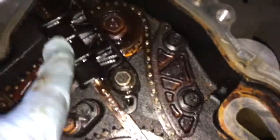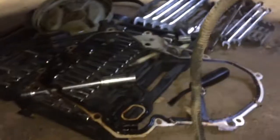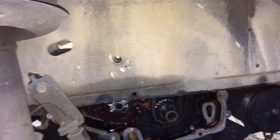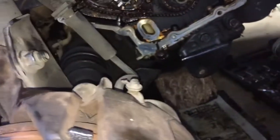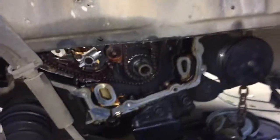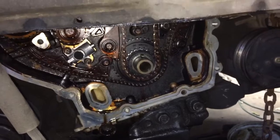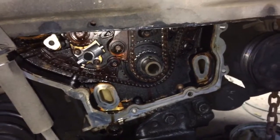The guide right here is in place. Now all I have left to do is reinstall my gasket, reinstall the engine mount bar, then I can put my timing cover back on, get my engine mounts put back on, valve covers, and all that good stuff, and we can turn it on and see what it does. Let me finish up here and I'll show you the finished project once I get done putting all this stuff back on. I hope this video was helpful.